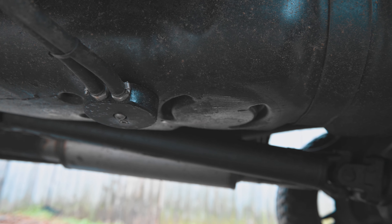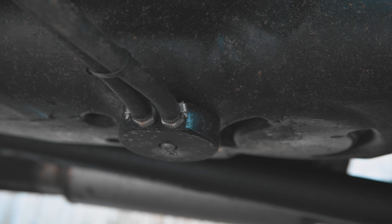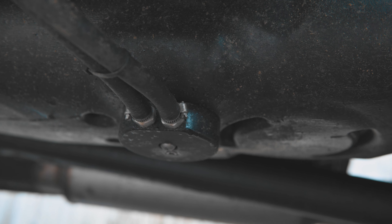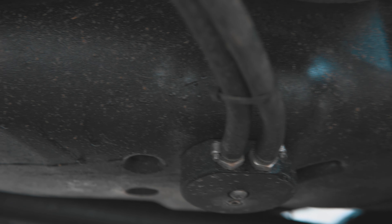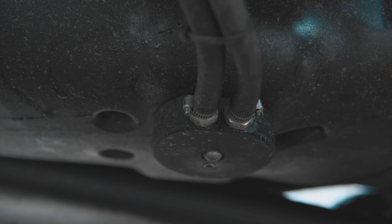So this is where I installed my sump. You'll notice it's right next to where the sending unit is — that little round indention there. I put it right next to it and that does work. You've got to be careful about where you place it because it's a very specific spot. There's a little hump right here and a little hump kind of right here, and if you put it right in between those two circular indentions, next to the sending unit indention, it should work perfectly.